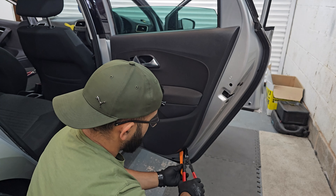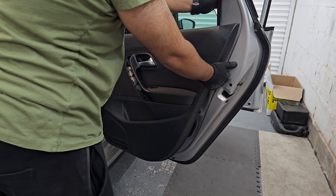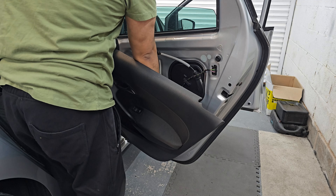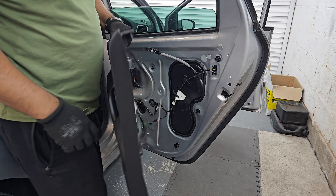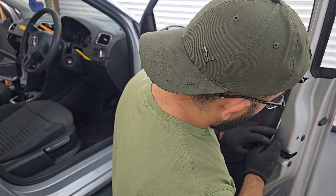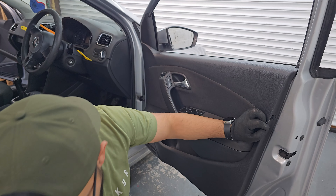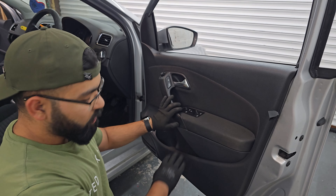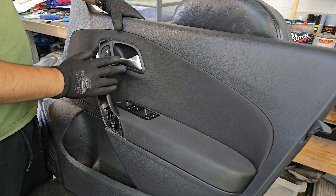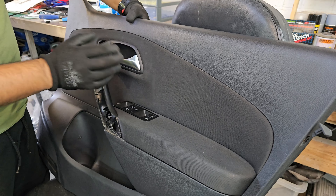Just take one of those pieces like this, then bit by bit lift it upwards. Undo the clips for the door handle and the door window switch. On this one, the rest of the door card is the same — it's just back here we've got a little plastic piece we need to remove. In here there's a T20 that needs to be removed, and then we can take the rest of the door card off. I'm doing the driver's door because it's a bit more difficult — it's got extra wiring — but once you disconnect it all, it's completely fine.